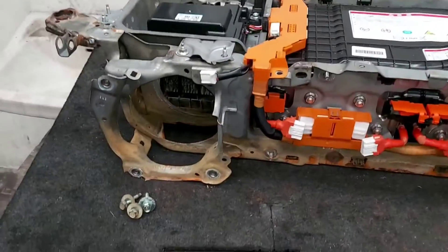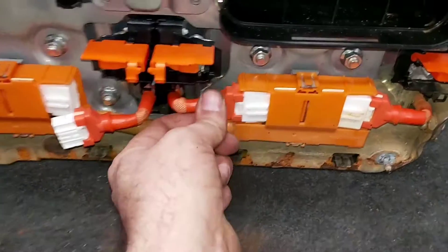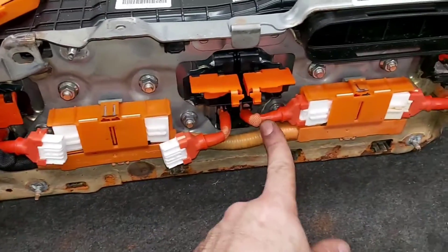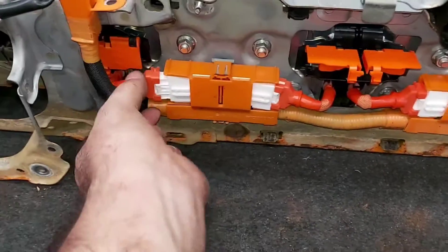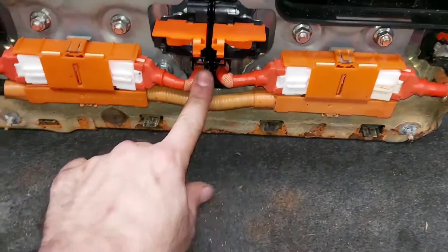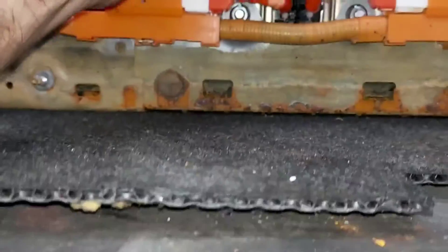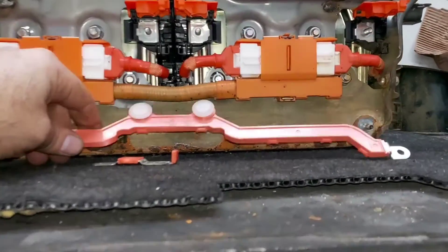Now at the rear part of the battery, these are the monitoring cables for the battery management unit. The BMU monitors the individual voltage of the cells and temperature. These tiny cables are covered in orange because high voltage runs through them - this is how we monitor the high-voltage system. Then we assemble the small bus bar in the middle and the large one.